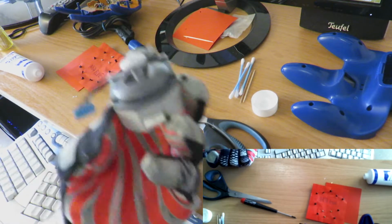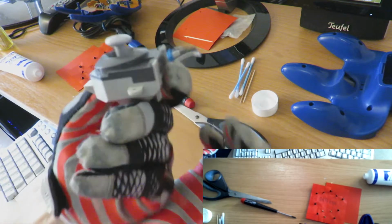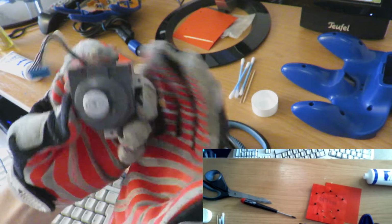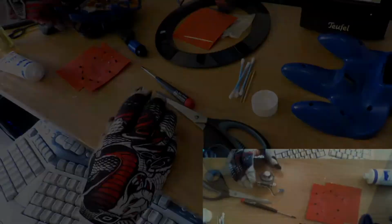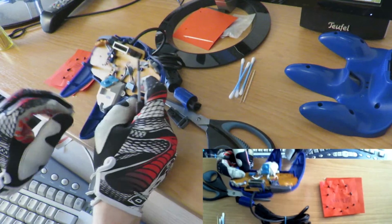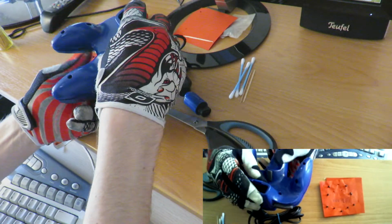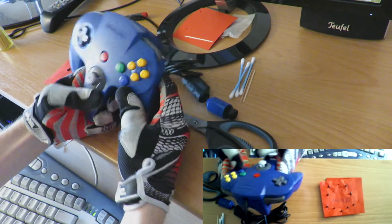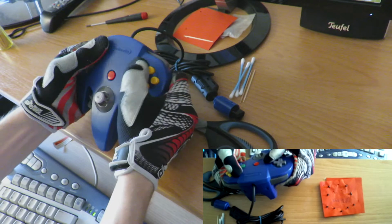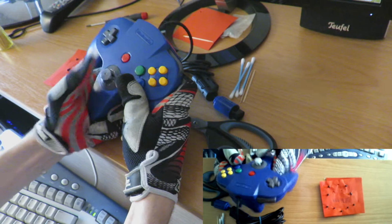You'll notice it when playing. You see, it's like new, not moving by itself, wobbling or shaking. Okay, time to fasten the 3D stick and assemble the rest again. Check your cables, so nothing will be cut by edges. Look for the small pillar to fit into the right hole. Check all your buttons, especially L and R, so they are in the right position.